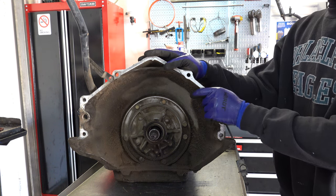I'm not going to have you watch me do that for that length of time, but that'll give you an idea. Like I said, this sprag, I believe, was replaced at some point. These retainers don't look factory to me. They look like some of the same retainers that we see on the new ones coming out from BorgWarner that are available now versus what was available back in the 80s. Just to reemphasize, never reuse this, always replace it on overhaul.